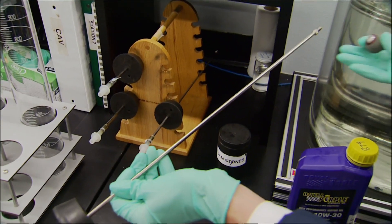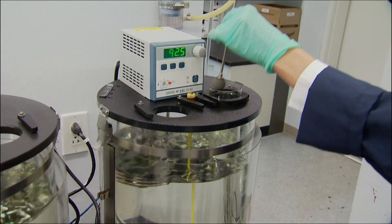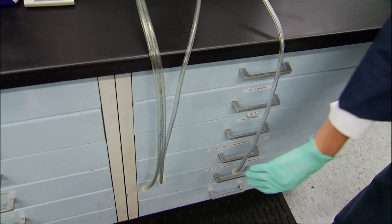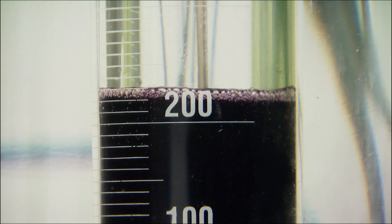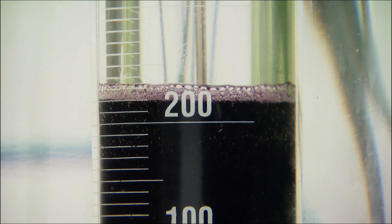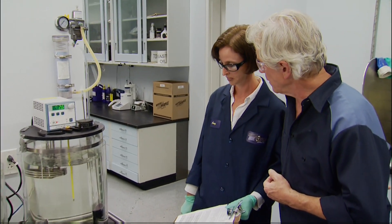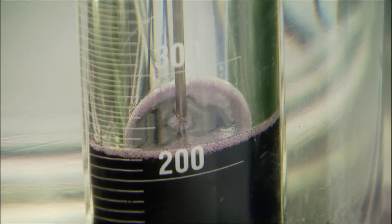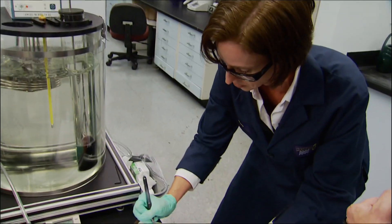After 10 minutes, a hollow tube is attached to what's called a foam stone, which goes directly into the oil. Then an air hose is connected to aerate the oil for five minutes. About 20 milliliters of foam sitting on top is acceptable - if you've got a problem, you'll see foam coming all the way up the tube. What's most important is how long it takes the oil to dissipate after aeration stops - 12 seconds is definitely a passing grade.